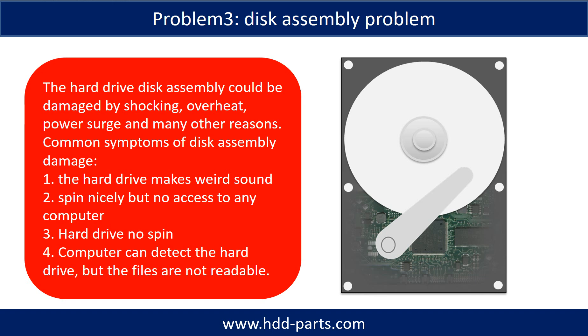Tips: If the storage is configured as mirrored hard drives, you can take the bad hard drive out, put a same-size or bigger hard drive into the bay, and the storage will mirror the data to the new hard drive automatically. If this trick doesn't work, that means the two mirrored hard drives are both damaged, or the storage was configured as RAID 0, meaning the two hard drives are striped.